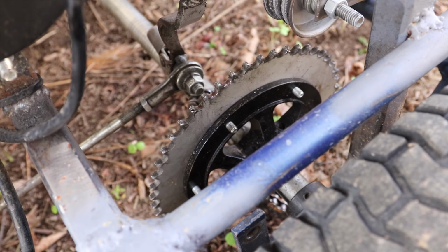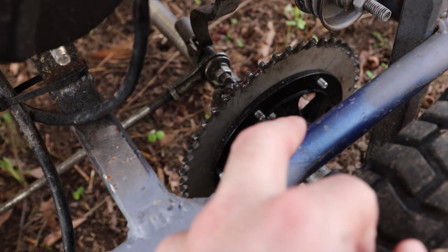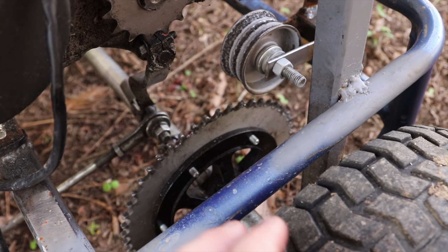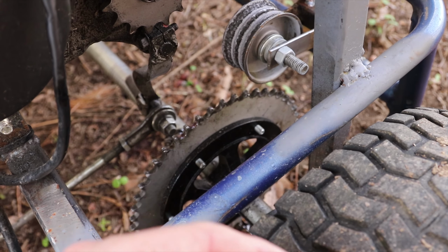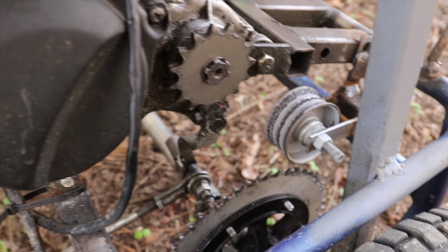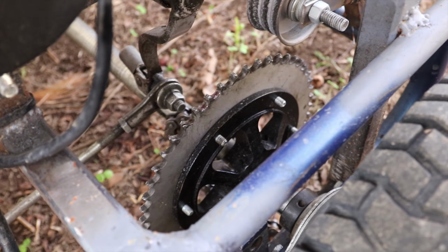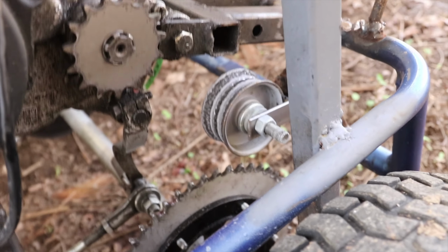This never worked right from the moment I got it. I got this sprocket hub, I put it on there, I tightened it down. It seemed tight. I was out of alignment a little bit, so I readjusted it, and when I went to tighten it down the second time, it doesn't stay tight anymore. So I would not recommend this sprocket carrier, this Go Power Sports sprocket hub.